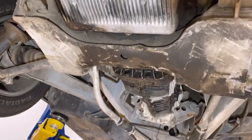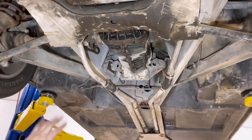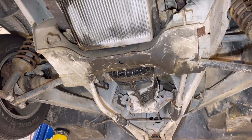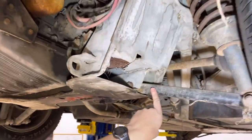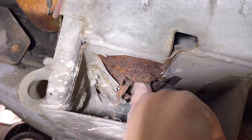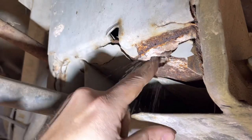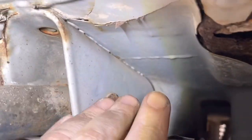Imagine you've seen some of the photos on classic car sites - they give you a shot of the underside of the frame, maybe an angle back here, maybe a middle, maybe a front - and that's really all you get. The important thing: if you're buying a car sight unseen, frame condition is important. Check out what we see in this cavity by the control arm - that's rot. A lot of it. This is blown completely open. My finger is through the frame. There's a spot here and another spot on the other side - I'm putting my finger right through. There's nothing there. That is rot. The frame is gone there.